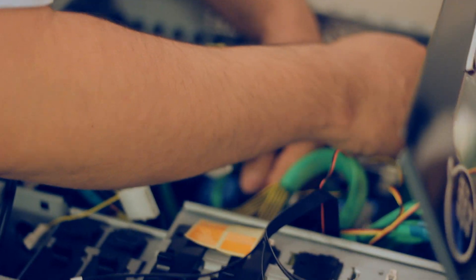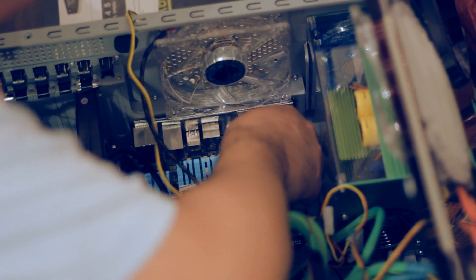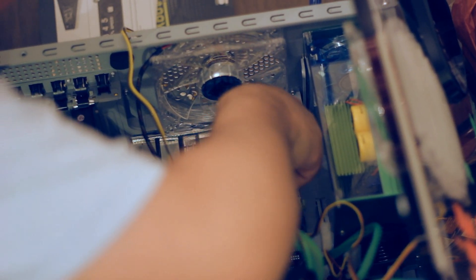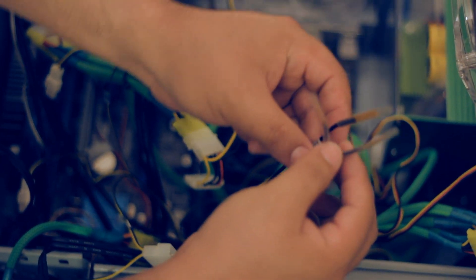So we peel it off — it has this sticker. We took the plastic cover out of the sensor, and now we are ready to stick it with the tape that comes included. Right now we are doing fan 1, which is the north bridge where the 9 series chip is installed. So we stick it to the heat dissipators on top. Just like that. After we turn on the computer, this will show us fan number 1 and give us the temperature and the speed of the fan.